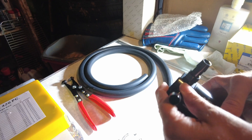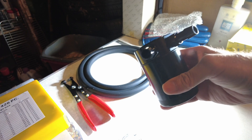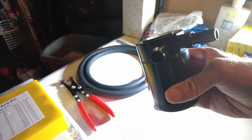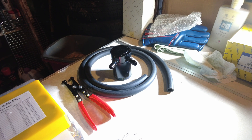The whole idea is that on the Jaguar S-Type R we have a plastic pipe running from the PCV — the positive crank ventilation — there's a little valve on the right hand bank, and that pipe runs all the way across through the V of the V8 engine, the AJ33S, and from there it enters ahead of the supercharger. When the engine's running, there are pressures that develop within the crankcase that need to be vented, otherwise that can lead to uneven running and leaky seals — hence the purpose of the positive crank ventilation, a concept that's been around for many many years.